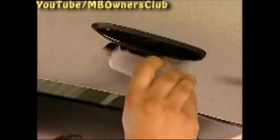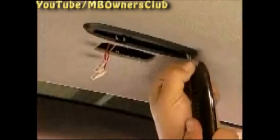With a long wedge, lever the roof lights from the roof liner and separate the plugs. Right next to the roof light, remove the Parktronic display. Separate the plug here too. Both baggage net holders on the left and right side must also be removed.